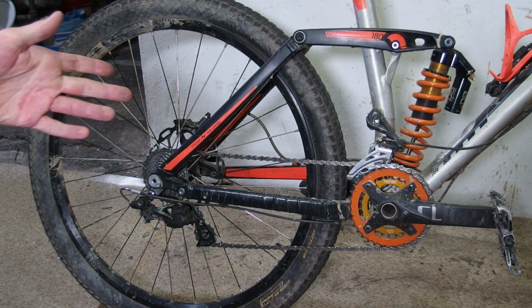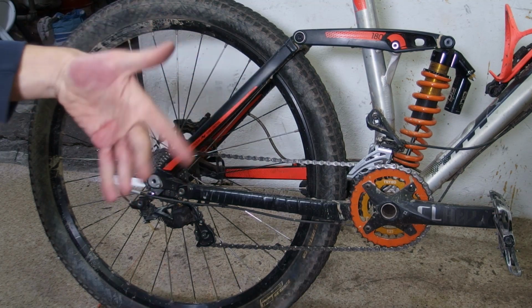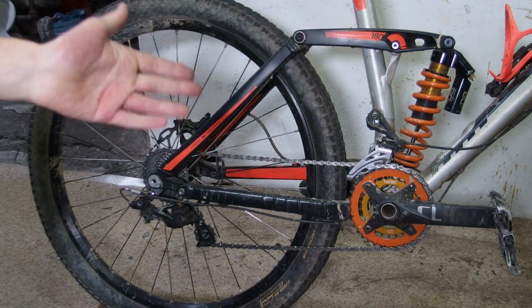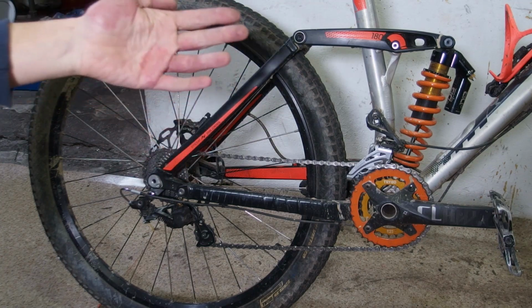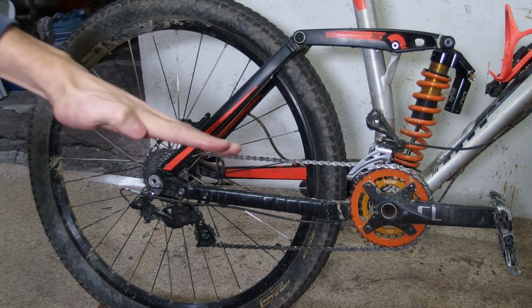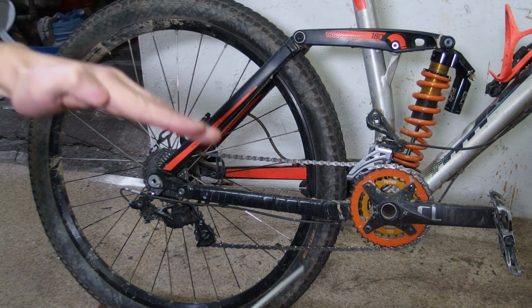Why is that being done? The reason for doing this is very simple. Your legs have weight. And as you are pedaling your bike, this weight is being shifted up and down, fore and aft, causing the center of mass of the bicycle to follow suit. This up and down movement acts like a hammer on your suspension, causing it to compress. 1, 2, 3 on each pedal stroke, the suspension is going to compress just a little bit through the sheer force of you pedaling.